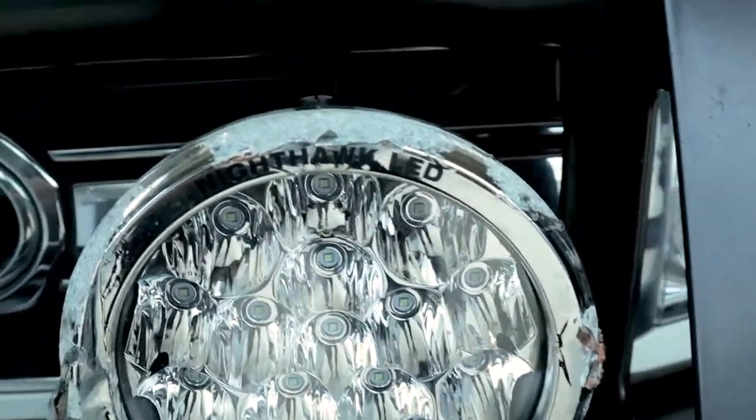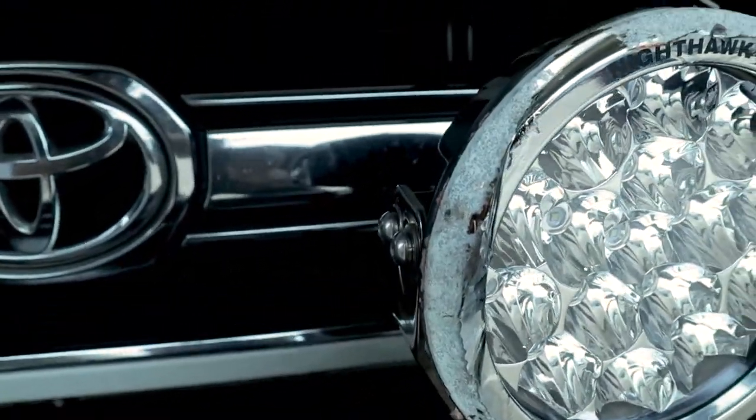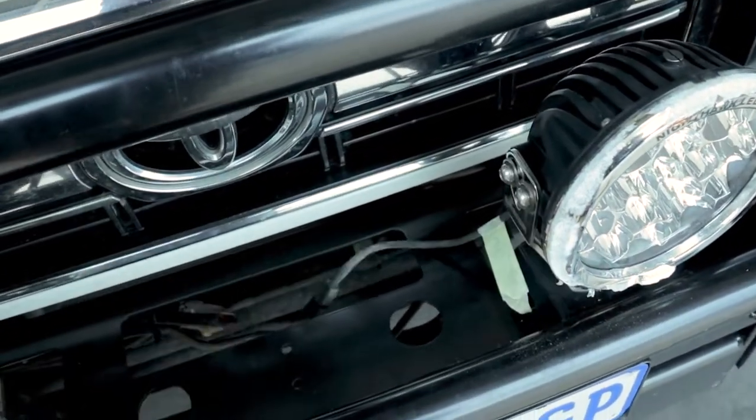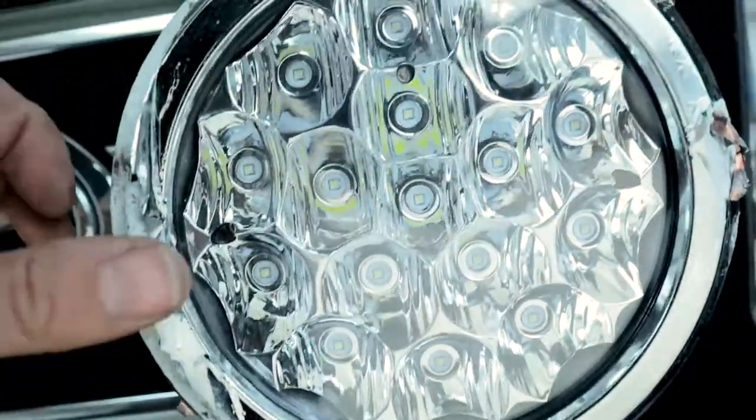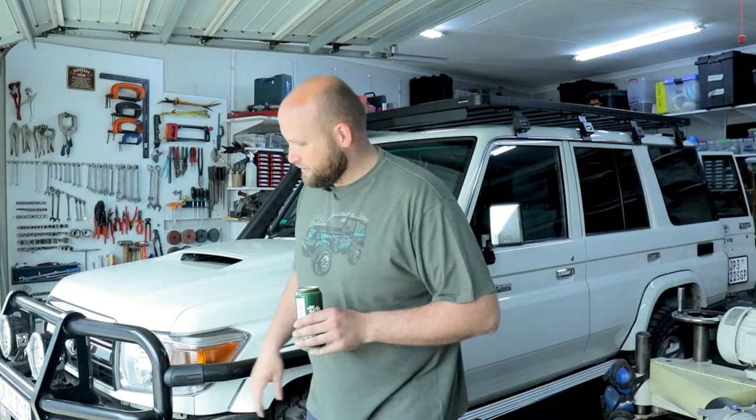A couple of small things still to do on the vehicle today. We are going to be getting rid of the two front spots for a very good reason. One, we almost never drive at night, especially when touring, so it's very close to sundown and we're off the road. Two, they're shot. And three, they just cut off airflow to the radiator. There's a couple of other mods that we intend on doing, but that's still to come. So there's a bash plate, seat covers, and then the ladder. So let me show you what's going on with the ladder.